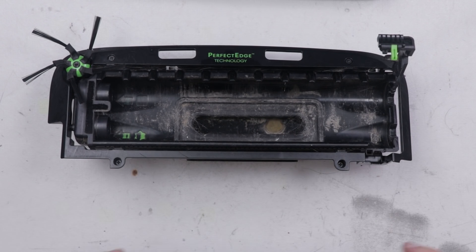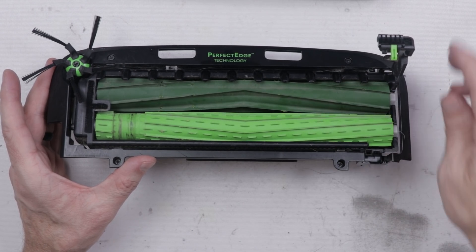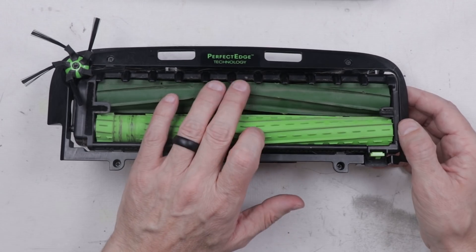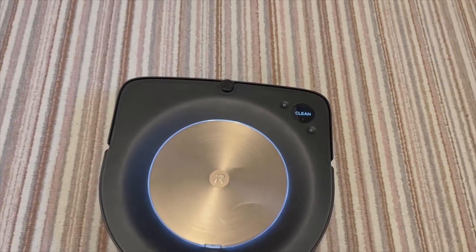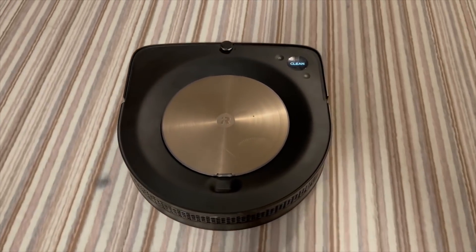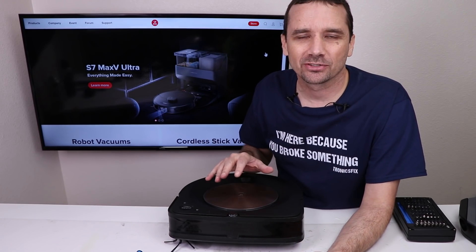Since I don't have new rollers to test, I'm going to take the rollers from number two — the vacuum that we know works — and install them into number three. There's still a little bit of play there, but really not too bad at all. Let's try these rollers in number three and see if it makes that noise go away. That's what I'm talking about. So I think what happened with number three is somebody replaced the rollers with rollers that just aren't good enough, and that's why we were having those noises.